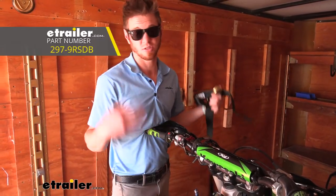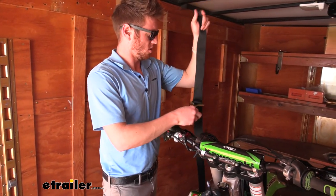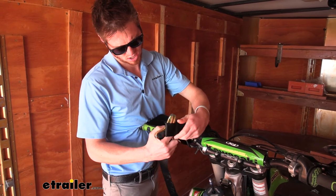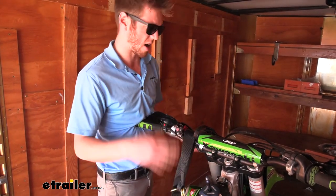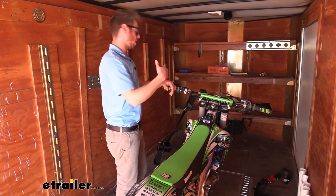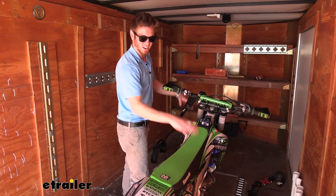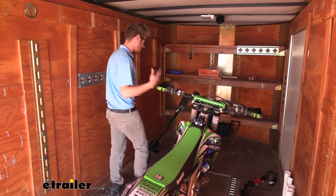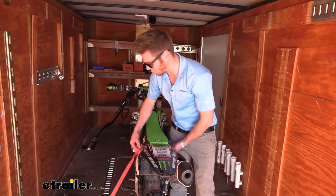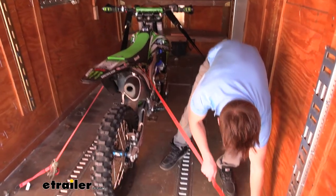For me, I'm using shock straps — they are the best whenever tying down any sort of wheeled vehicle in my opinion, and these do come with soft straps. I'm going to use the strap to wrap it around my bars and then take the hook and go through that little strap — this way I'm not going to have to worry about scratching my bars. If you're doing this by yourself, I suggest taking one of your straps and hooking it on so it's kind of leaning that way and it'll stay up by itself, then go ahead and take the other strap and strap the other side. For the back, I just bring it through my air box and hook it up somewhere farther back.